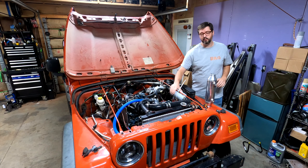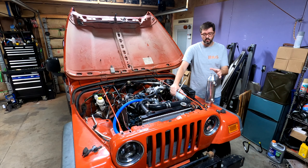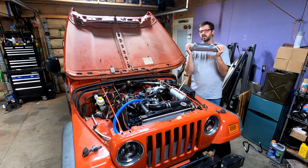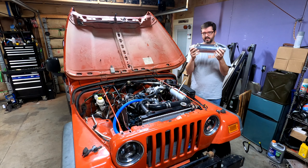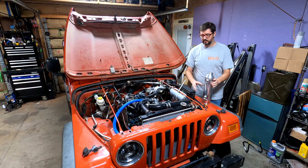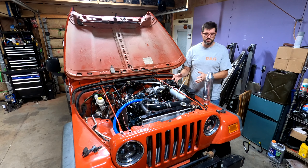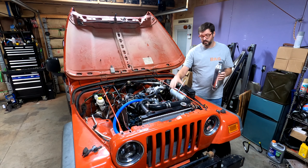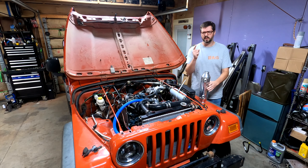The one we are going to be trying today is switching out the 4x6 barrel style intercooler with a 4x10. I'm wondering if the larger volume that this intercooler provides will help reduce the EGTs further. So the first thing I'm going to do is figure out how to drain this loop, and then we're going to get to working on installing this intercooler where this one currently is.